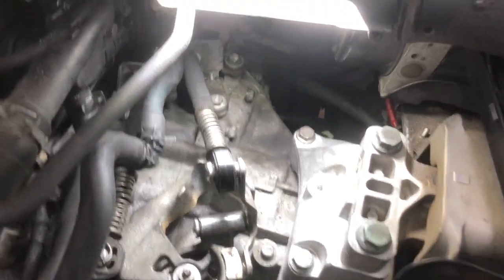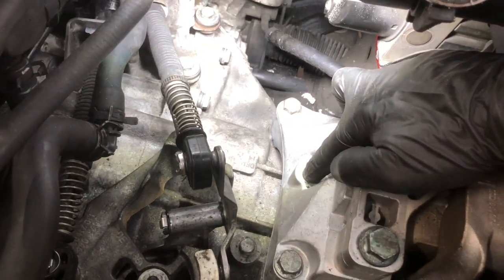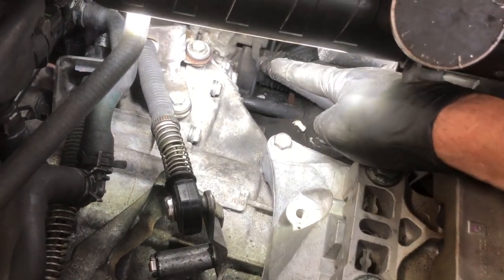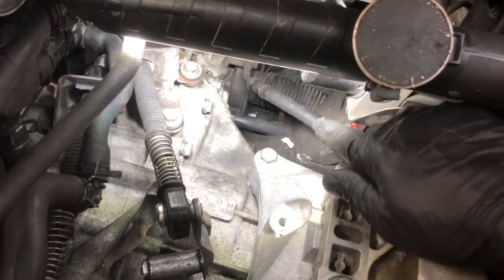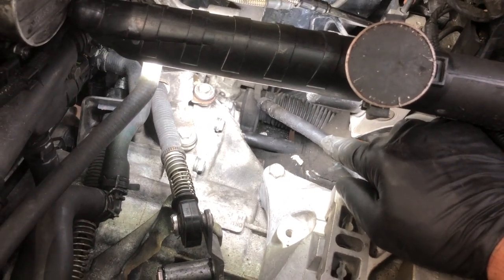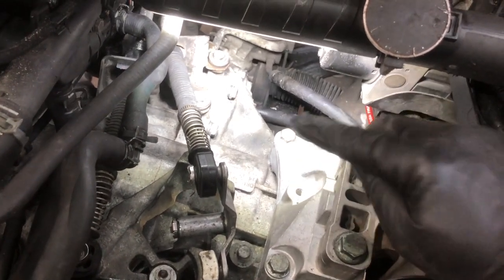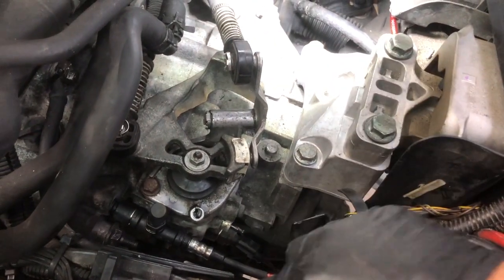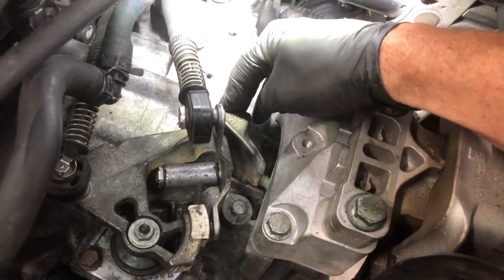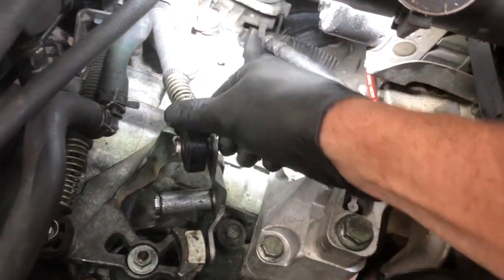One technique that I have used before that worked well was still bring it up over, put a longer bolt with a spacer so it sits up high, and do a little bit of contouring on the rigid parts. Be gentle and be careful bending it, because obviously if you kink it now, it's no good. So you got to be careful, but you can recontour those a little bit, and sometimes you can get it to come up over and sit up about 4 inches higher, come across and go down, and give yourself room for that shifter.